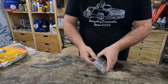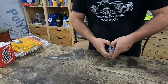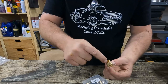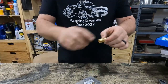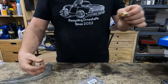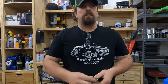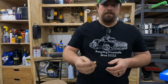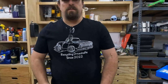So these are quarter inch, obviously, and we just have to figure out what size we actually need. You could take this fitting and solder a copper tube in here with the sock on the end of it so we can have an extended pickup that goes through that small hole. And then we can bottom tap the tank for an electric fuel pump so it's gravity fed to the fuel pump so that we don't burn up electric fuel pumps. So that's the plan, and that's the reason we're going to go ahead and modify that tank now.